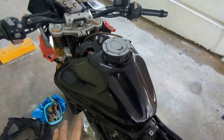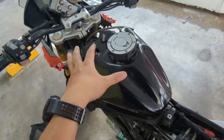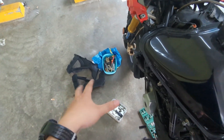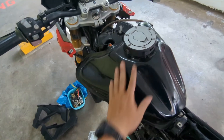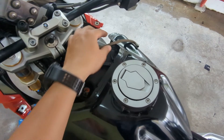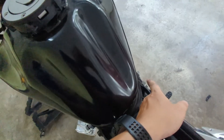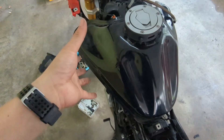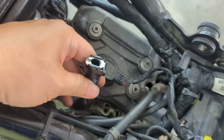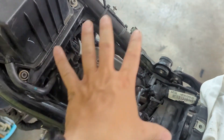So we took out the tank. There are really a lot of nuts in order to take it out — on the tank alone there are like 12 bolts, and to remove the side panel there are probably another 10 more on each side. We unplug the overflow hoses, loosen the two 12mm bolt nuts on the side of the tank so it can slide out. We then unplug the fuel pump clip and the fuel level sensor, and now we have clear access to the engine area.